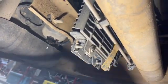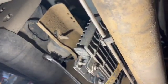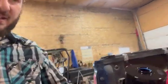So with our 1 7/16 wrench, we'll put it on here and we will slowly spin it off. Apparently my trouble light is dying on me. And it will unthread this housing. And that is how we get at our element. All right, so we've got our old filter off in the basin here. It's used. It's dirty. It did its job.